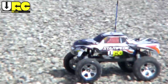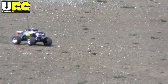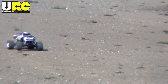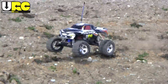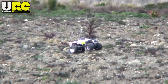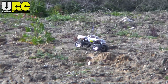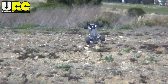The Stampede tends to skid around everywhere. Surprisingly for how tall-riding it is, it doesn't have a lot of body roll — that's because the suspension is very stiff. The springs are long and preloaded, which makes the Stampede drive around in a very non-realistic way. It's good for stability and handling in general, and really good for jumping. But you'd expect a truck with this high of a ride height and tires this large to do really well over rough terrain, and the Stampede doesn't. It has the clearance to get over stuff, but it just bounces and waddles and rolls and flips a lot. Each tire ends up taking each bump as a jump.